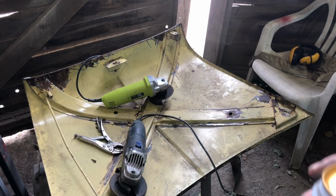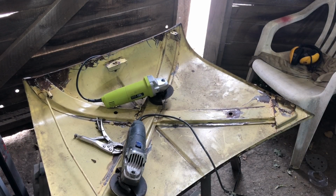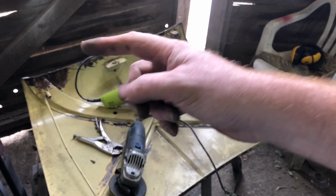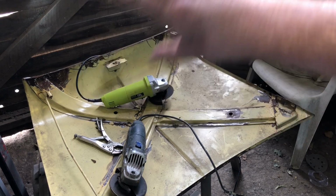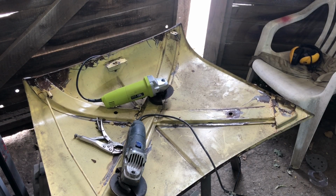Okay, what am I thinking? Got a lot of surface rust. Ideally, it could do with the shot blasting really, because it's easier to get into all those nooks and crannies. Or at least the framework needs to be shot blasted. Best not to shot blast the whole bonnet, because I've seen that before. Depending on the shot blaster, it causes it to dent and buckle.